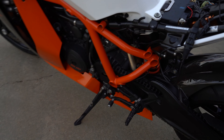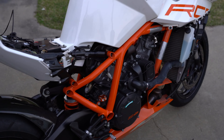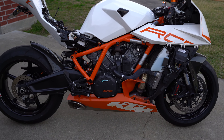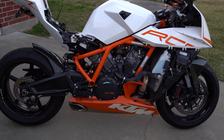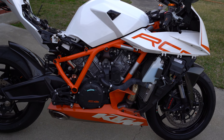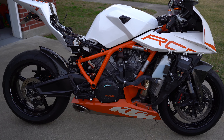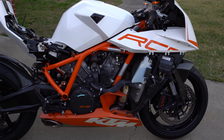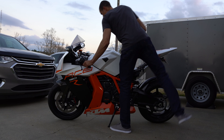Once you're done with all that, you do what's called a driveway test. Bring the bike outside, sit on it, hold the clutch in, and shift all the way into sixth gear while it's running. Rev it to 5,000 RPM and then try to shift like you're going into seventh gear. You should hear a distinct disruption in the exhaust note, which tells you the quick shifter is working.